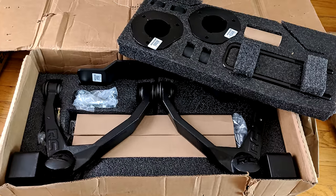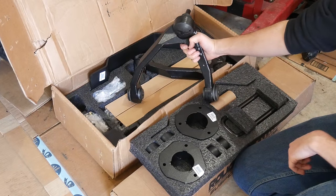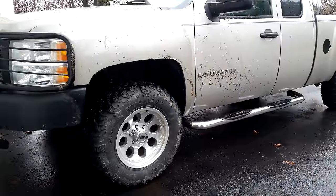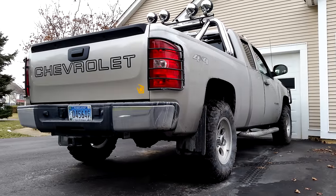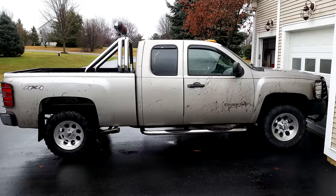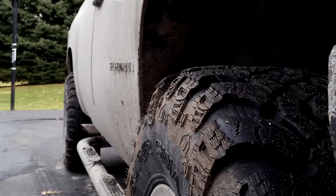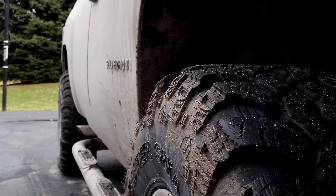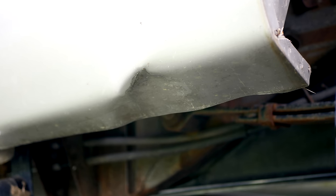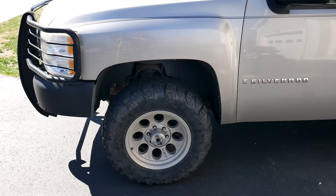I always wanted a lift kit anyway, so I ended up waiting a few years and ignoring the tire rubbing. In March 2019, I finally got the opportunity to buy one of these kits at the best deal I could reasonably expect. In this video we'll be installing the suspension lift part of the combination kit. This part is advertised as a three and a half inch lift — raising the front three and a half inches over stock and the rear about an inch and three-quarters. Since we already have a leveling kit, this should only add an inch and a half to two inches to our ride height.